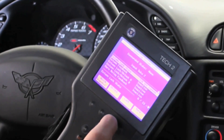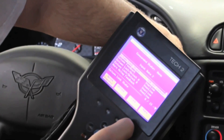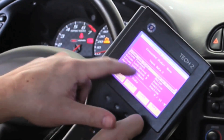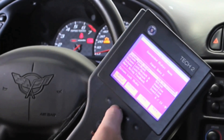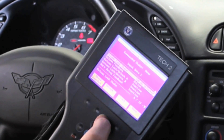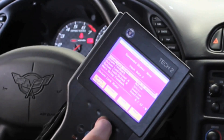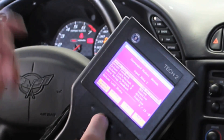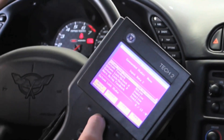Just something to be aware of. I'm going to go ahead and install the key and turn the key on. You see it says ignition on, unlocked, column feedback active. If we try to lock the column, you'll see just one of these actuator states change. You can also hear the relay change states. You do not see the column feedback change, you do not see the column lock state change, and you do not hear the actuator change.